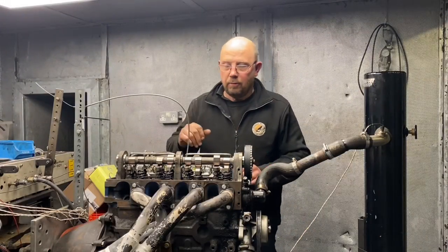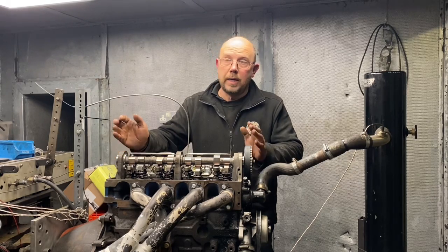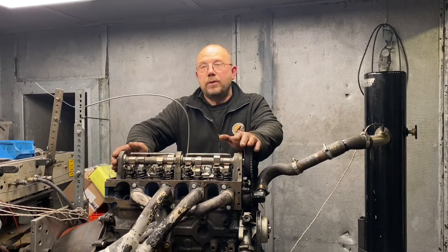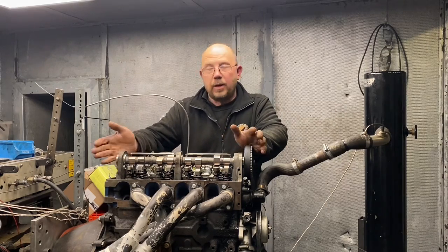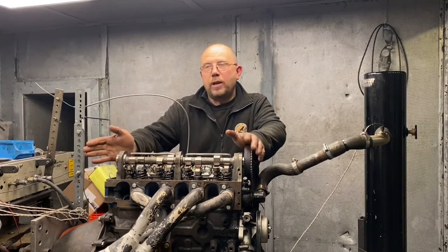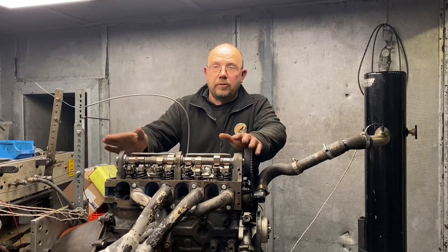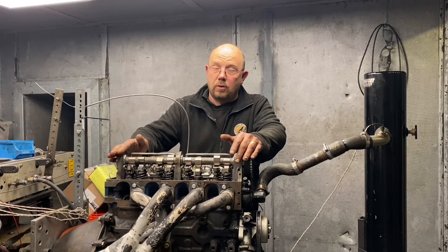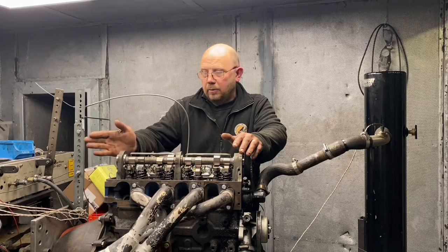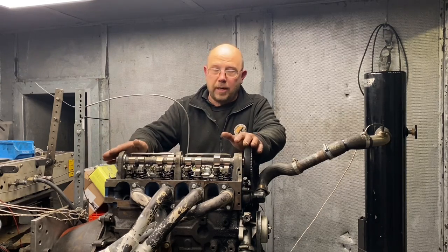The cylinder head belongs to a client of mine, Ross. He currently has a completely standard full Pinto engine in his kit car, the only modification being a pair of 40mm side-draft carburetors. He's looking for a bit more go, so he's purchased a big valve injection head. From memory it's got big 46mm inlet valves, oversized exhaust valves, and I've chosen for him a Phase 4 Newman cam.